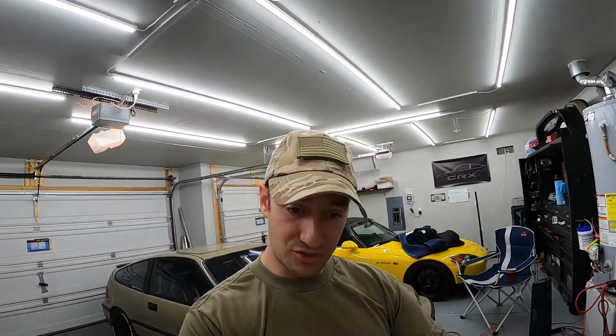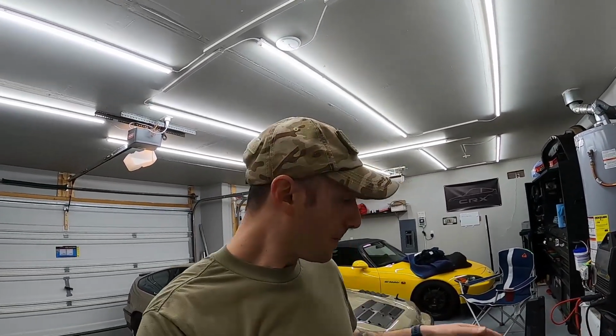When you make the shifter as short of a throw as we did, which was the max as short as it can be, it basically lowers the shifter down, and it essentially bumped into his exhaust. And he's got a stock exhaust in the car that comes with that EF sedan. So keep that in mind, if you're gonna buy it and run that, if you go that low, you might have to do some modifications to make it clear your exhaust. But again, you don't have to necessarily go that low. And for the price point, I don't know if you can necessarily beat the quality and everything that it is.